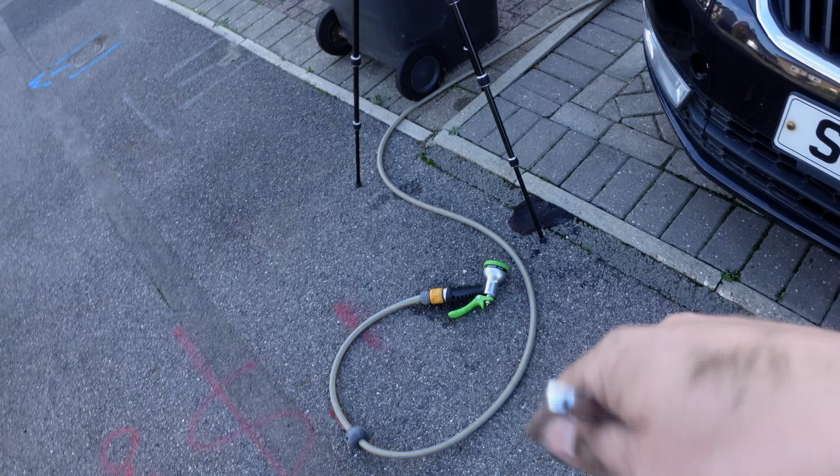I'm not gonna do the whole thing. The rest of it wasn't affected by the fire. So I've concentrated my efforts on this bit. Hopefully it comes out good. I now need to put a little bit of primer on it and then sand it smooth to 800 grit to get ready for paint.